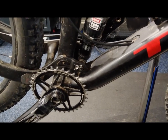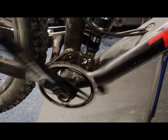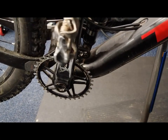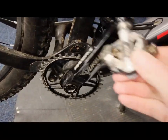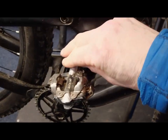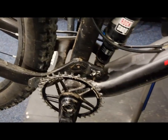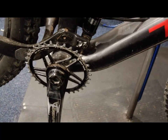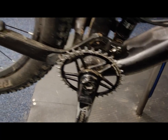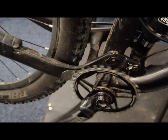Okay, so it spins and gets an okay number of free spins — the BB is going okay considering how hammered it is. This is probably somewhere around a half-watt loss bottom bracket. Now I've just really over-tightened the preload, which will introduce a lot more friction into the bearings. Now doing a free spin — not amazing. Being not loaded under actual pedaling load, the reality is I now probably have somewhere around a two-and-a-half watt bottom bracket loss due to the increased preload, as opposed to before which was a typical half-watt BB loss.